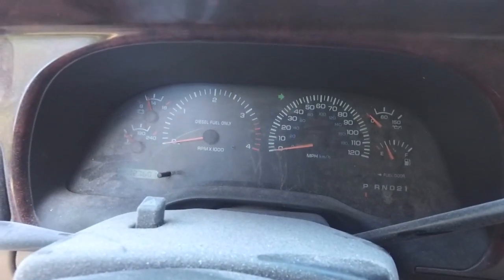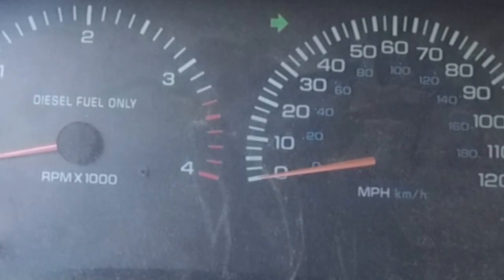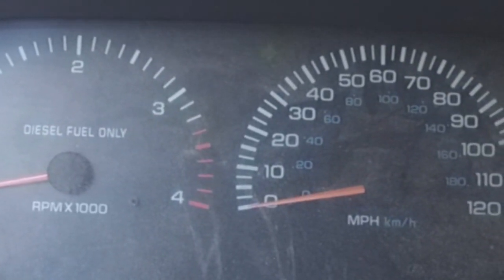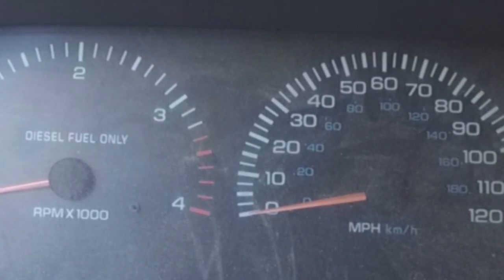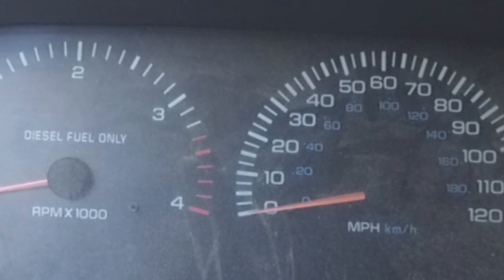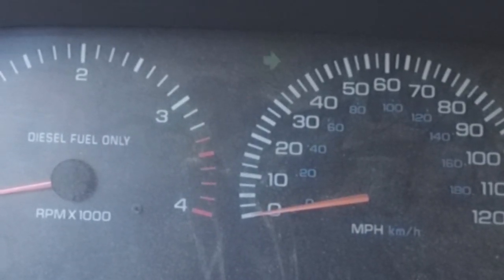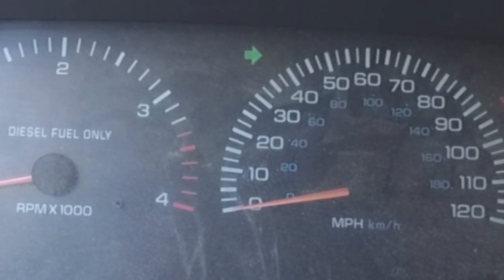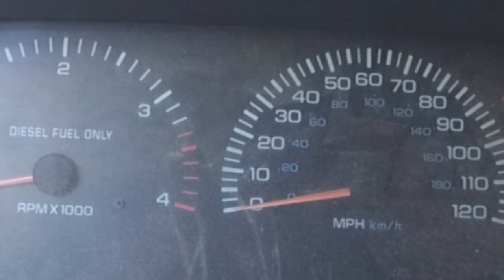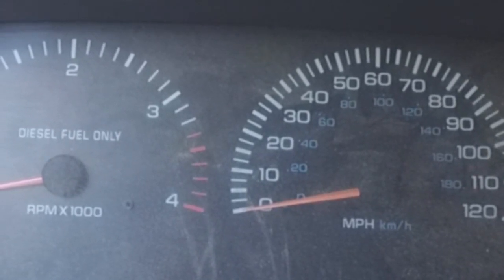So the next time you see your blinker on your dash panel blinking erratically or super fast, get out when you get a second, double check on the side that is blinking that way, and you will find that you have a burnt out bulb. And then you can just get it replaced and be back on the road safely, so you let other people know the direction of your travel.